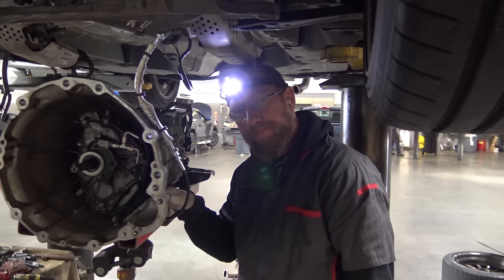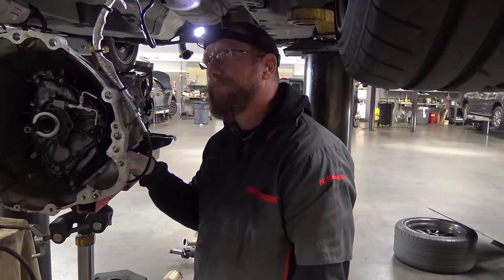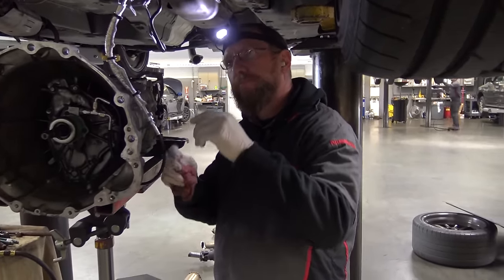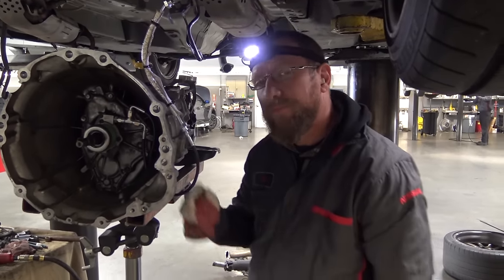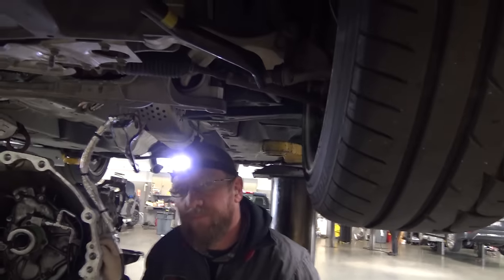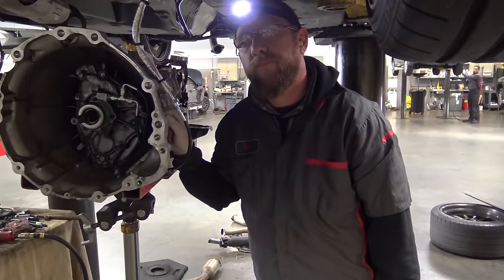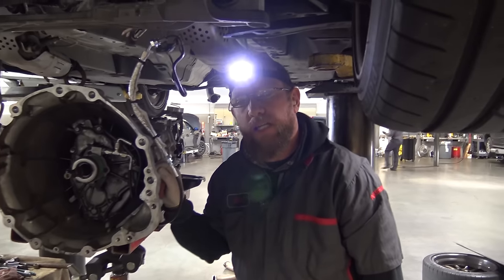Obviously, with my 350 having a brand new, rebuilt Brembo system on there, it's the track version, so from 2004. But with, like you said, the upgraded StopTech slotted rotors, stainless steel lines, and the higher temp brake fluid, quite a few people who've driven my car have said it feels like you've got a lot of initial bite with my brakes. This car, in its current condition, doesn't. So that's why I'm having you do stainless steel brake lines and flush it with new pads. Do you think a lot of the sponginess I feel right now is just wear and tear on these brakes?